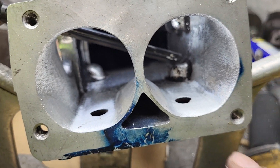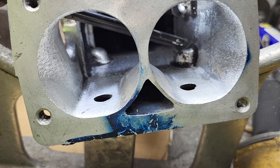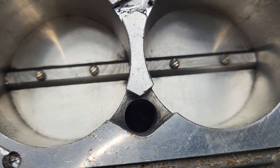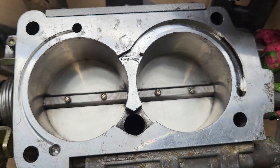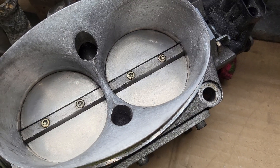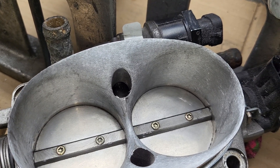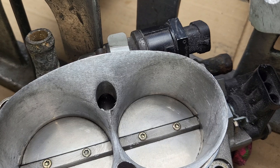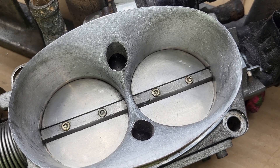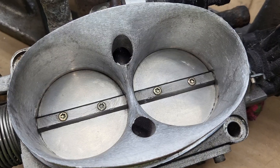This section right here is a little thin but it doesn't matter - there's no metal there on the throttle body, at least my BBK. My BBK doesn't have any metal there so it doesn't really matter how thick or thin that is. I did do a little work on my BBK, and the only reason I did is the customer hasn't sent me a throttle body and I may not even get it. So I took my rougher burr texture off and did a sand roll texture. Yes, it actually cost me a few CFM - it doesn't sound right, but it did. I felt it was a closer representation of if he bought a throttle body and bolted it on with everything else I put together.